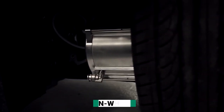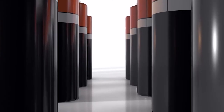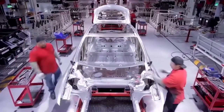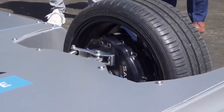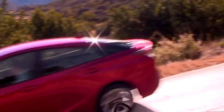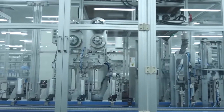Are there any disadvantages of in-wheel motors? The major drawback is cost — having two or, in some situations, four state-of-the-art motors can vastly increase your automobile's cost, not to mention increased vulnerability to unfriendly outside forces. Ultimately, there is the concern of durability. Being so close to where the rubber meets the road in an unsprung manner means in-wheel motors need to be capable of absorbing significant pounding. Each manufacturer will have to prove itself when it comes to long-term reliability.